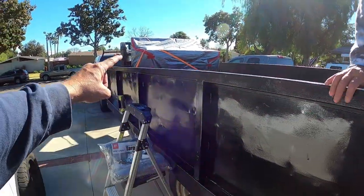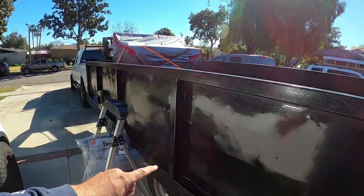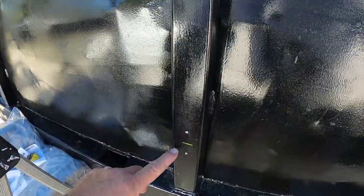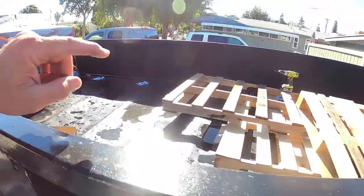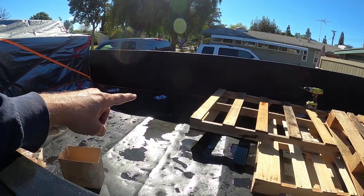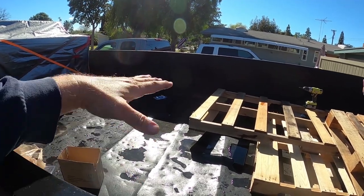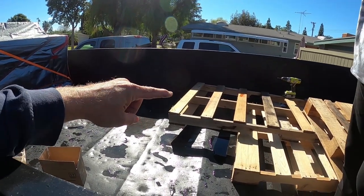I would say 10,000 pounds is plenty. I'm going to put one on every one of the upright supports — I'm not going straight into the sheet metal, let me show you that. Along the bed we have these two-inch tube steel supports. I'm actually putting these right in here. I've already marked a couple of pilot holes and measured six inches up. I'm putting them on the inside of the bed about six inches up. I could do a strap over the top, but if my load isn't high enough, the strap will never touch the load. So I need something to tie it down on the inside of the bed.